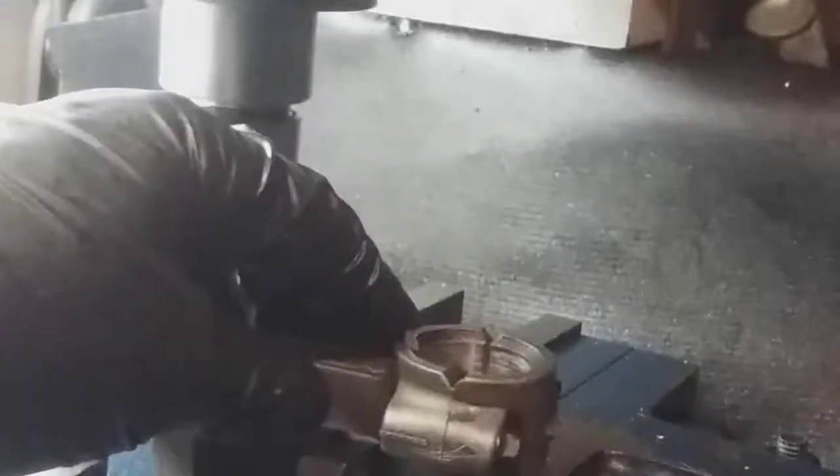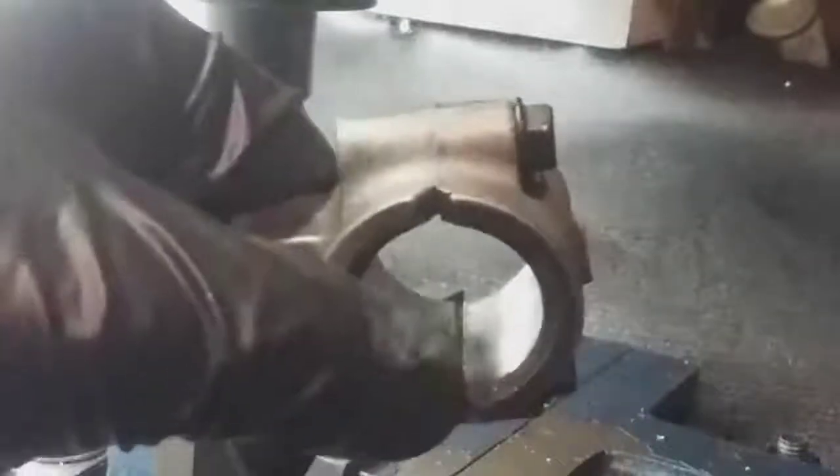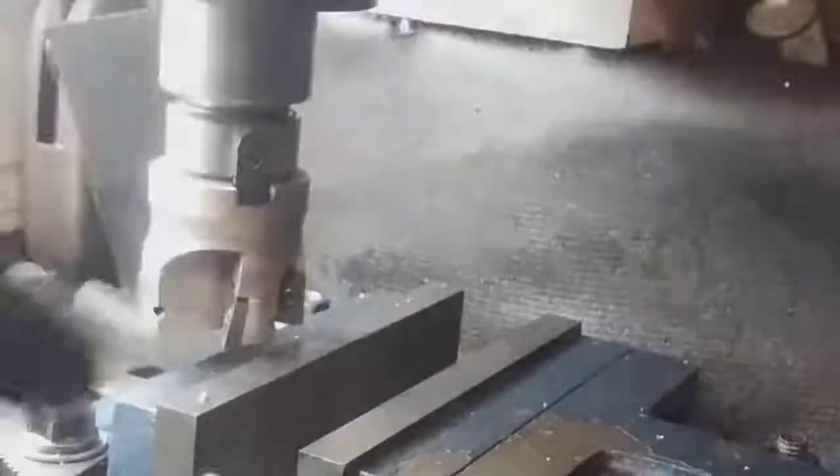I just got to figure out how I'm going to hold it because these are just cast parts. I'm not sure how I'm going to clamp it down. I might want to put some packing underneath. For the oiling, it's got a little bit of an angled taper - kind of like a chamfer. The oil just gets slung up in there. There's no pumping - it just splashes down into the oil bath. But that was the problem - that part broke off. So now I'm just refurbishing this and figuring out what I'm going to do about an oil slinger - either running a higher oil level or putting something on here like Briggs and Stratton does with a flat plate that dips in the oil and splashes around.